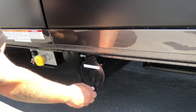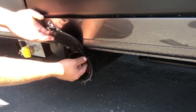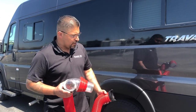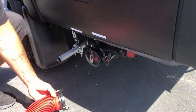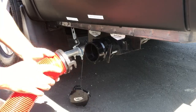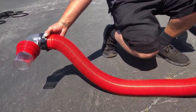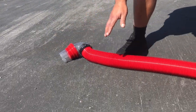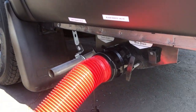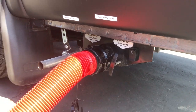After you've connected your power cord, the next step is to hook up your sewer hose if your campsite is a full hookup, which includes electrical, sewer, and water. You'll find your sewer hose stored on the driver's side in the sewer hose storage. Turn this little lock down, open it up, and pull your hose out. Come to the driver's rear where the exit of the gray waste and black waste are, twist the cap off with the valves closed, then hook up your sewer hose and stretch it to your campsite's sewer inlet. Leave the black and gray valves closed until the tanks reach about two-thirds or full — you'll be able to see that on your sensor.